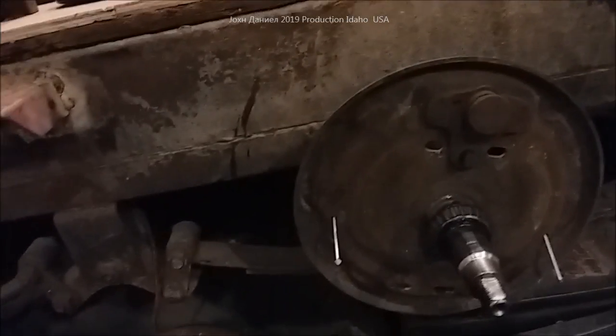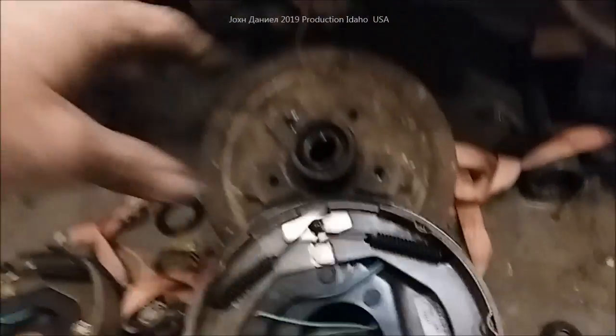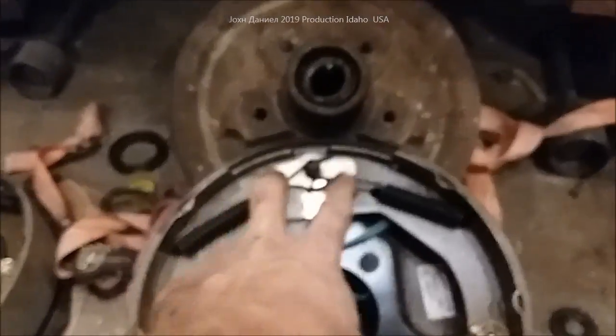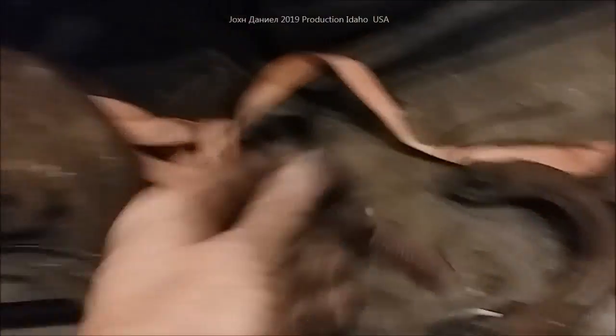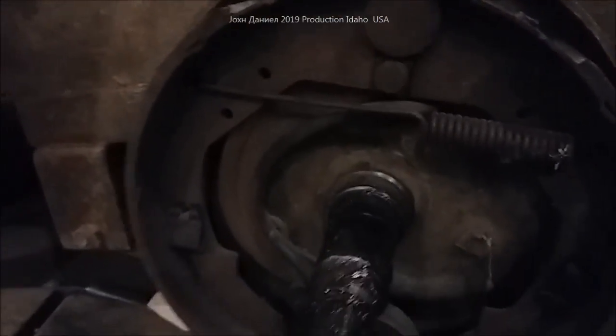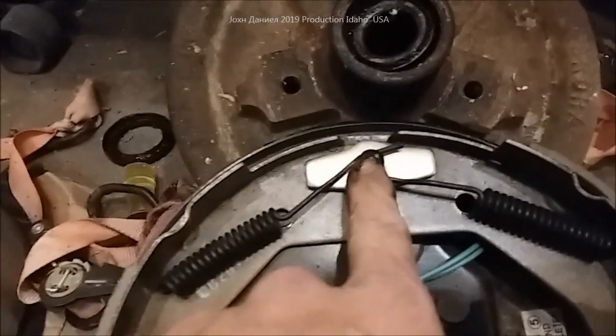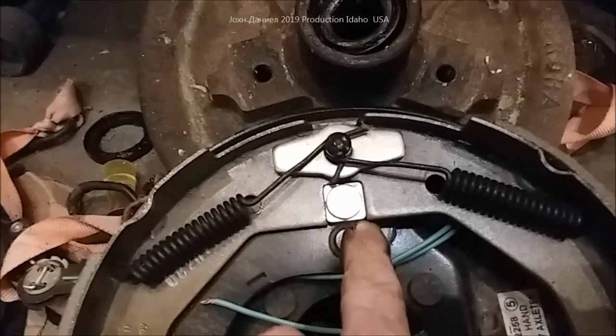The solution is disassembly and reassembly using the existing hardware. You're not going to be using these points here on your replacement brake assembly. Do not throw away or break your spring — this is your return hold spring. The lucky thing is the old brake shoes and the new brake shoes already have your spring down here mounted at the bottom, and they have the same style brake adjustment. The only difference is how this hardware is made right here. Your cam is still the same.